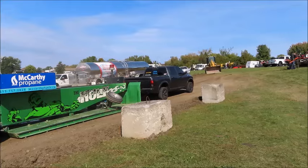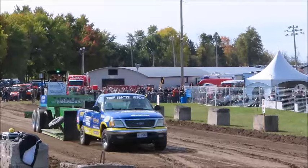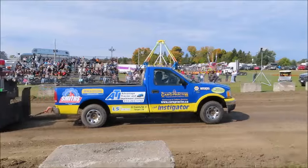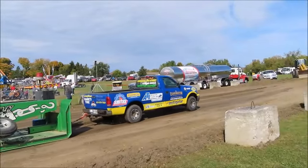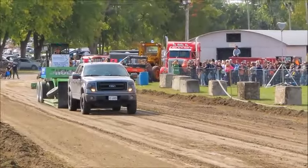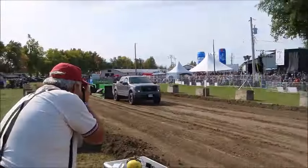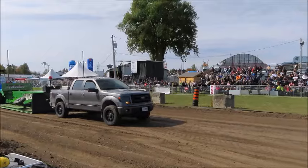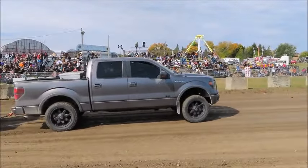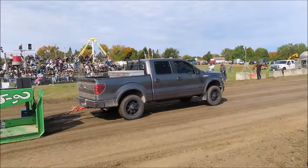On the right-hand side you have really good traction. We're trying to keep as much speed as possible. He's in high range — that's why. You need to be in low range. You've got to be in first gear. If you're in low range, you need all kinds of RPM. And if the transmission needs to shift, that's a problem.